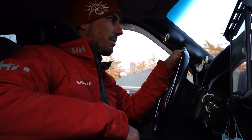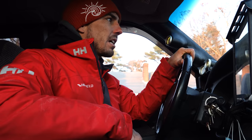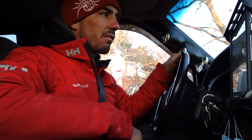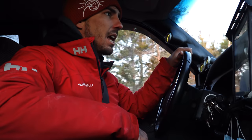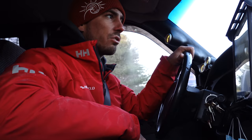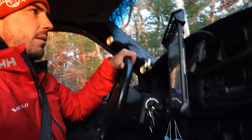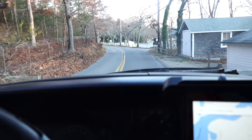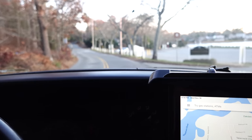The brakes actually seem really nice. Like it doesn't feel like it's taking much extra braking power from my truck at all, because this thing has hydraulic surge brakes and it's got a brake on each wheel, so four brakes total because two axles, four wheels. Let's see as we go down this hill. I'll brake right at the bottom of this hill. Yeah, I mean, braking is easy.